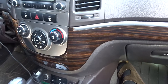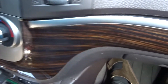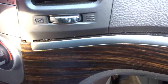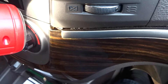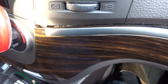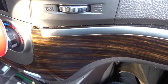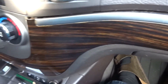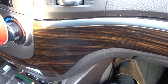Getting this on hasn't been quite as easy as I thought it would be. I'll show you why. Right in here at the bottom of the vent frame there's a little plastic tab that sits down, and there's a corresponding tab on the wood grain trim. The vent tab needs to go on the outside of the wood grain tab, but there's a screw hidden by the tab that holds the vent. So it just needs a little prying to get it in. I had difficulty getting this on, but now I can see why.